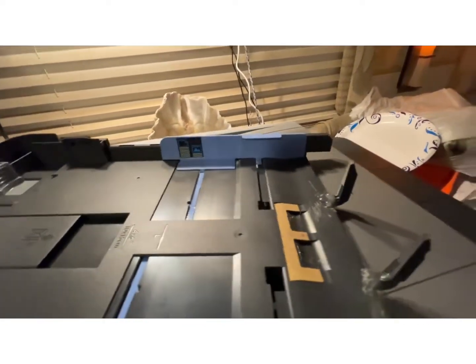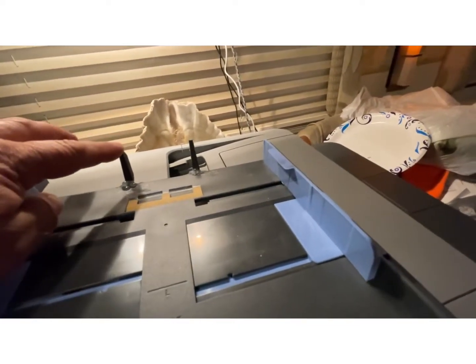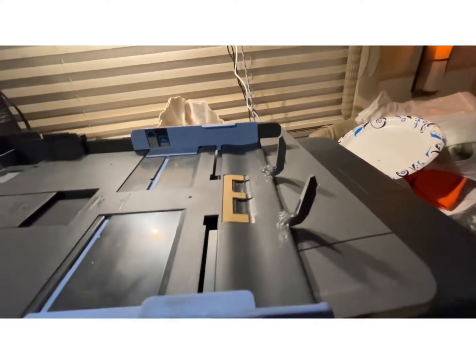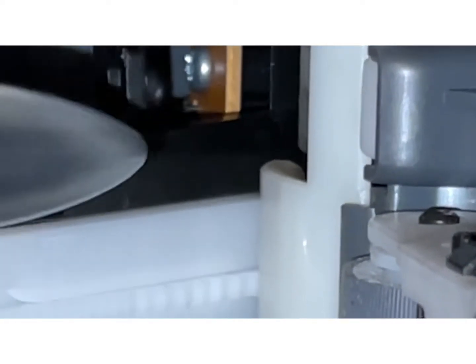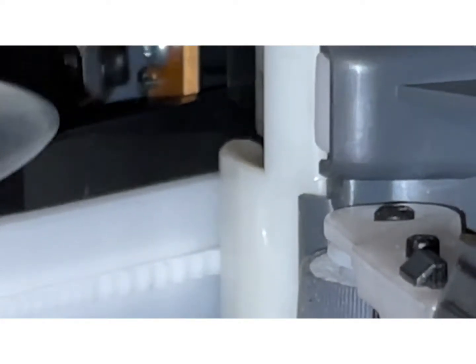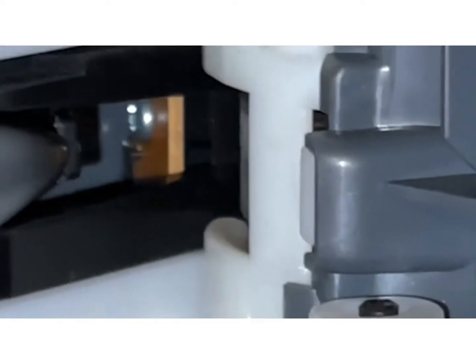So I looked at a couple more videos and what you need to do — on the left one as you're looking at it from the front of the tray — there's supposed to be a piece sticking out this way like that. That part that protrudes off of that arm on the paper tray should move in and depress that little black piece right there, square in it over the screw. When I do that, it clears the tray-being-open error.